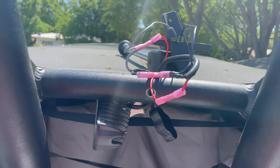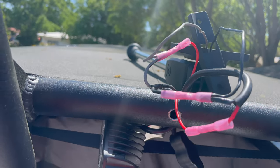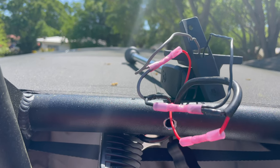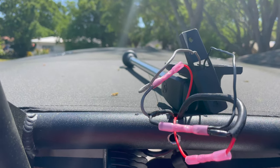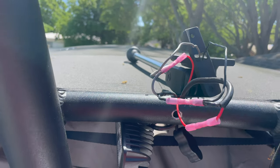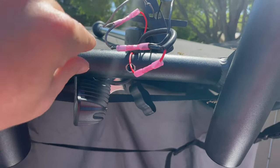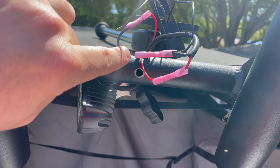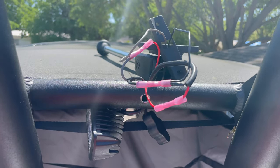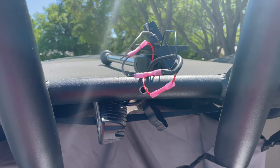When you're done, this is what it should look like. You should have a red lead coming off your switch going into the power for your navigation line on top. What you see here is the split in the power for your navigation side going to the switch, and then the other switch side goes to the power lead of the light. For the grounds, they all go into one bundle straight from both lights into the ground and into the ground to the switch. I still have to heat shrink this and I'll come back to show you the finished product with wires tucked away and the operation of the switch.